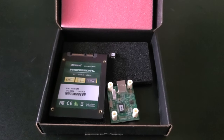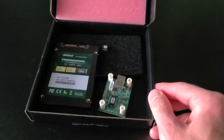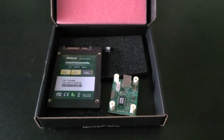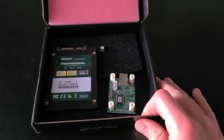Here's the hardware: SSD, security chip, and CID — all brand new. When you order this kit from IT, you'll get a full kit with a control deck, a trackball, a wiring harness with extra buttons, new artwork overlay for the arcade collection, a new lighted marquee, and of course the CID, security chip, and hard drive. The hard drive comes as an HDD — I've already cloned mine to SSD, which is less problematic and easier to store.